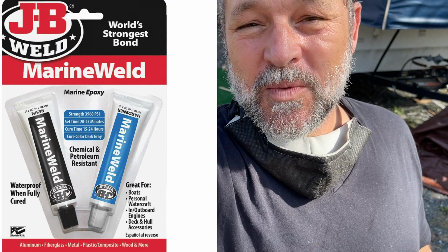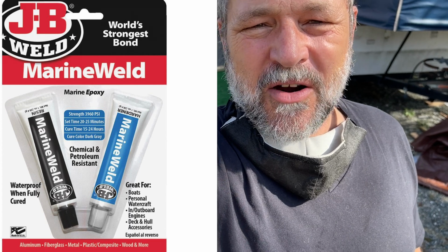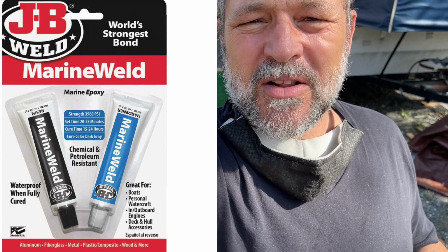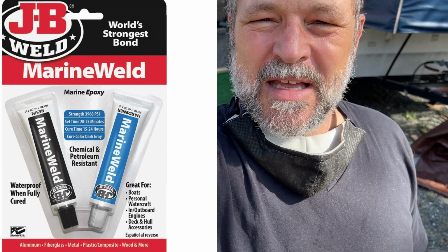And we JB welded them, letting it sit for a full 24 hours after scraping down to the metal, a little steel wool, a little vinegar, and then drying them. And I think that's it. I think it's going to be dry. Certainly drier. Nice patch there, and this one, we did the whole line there.